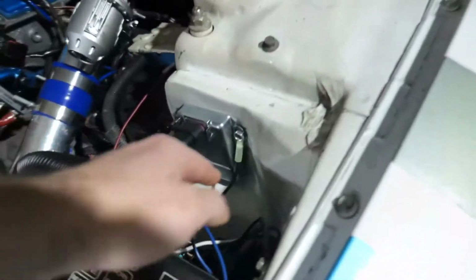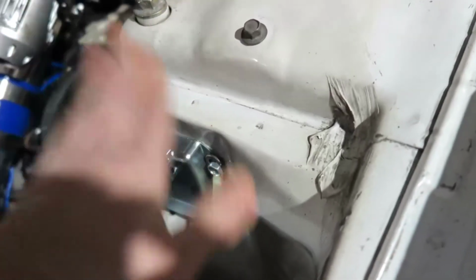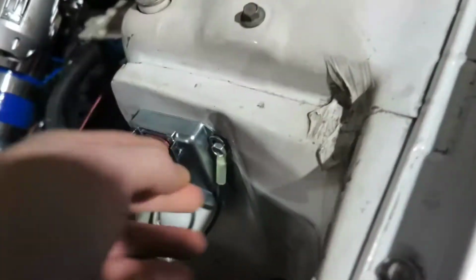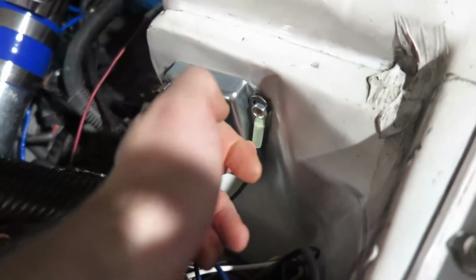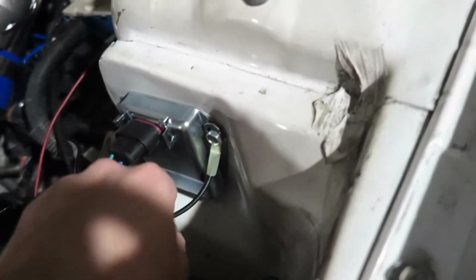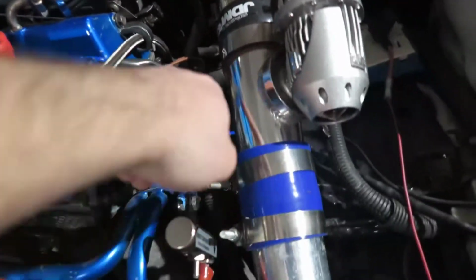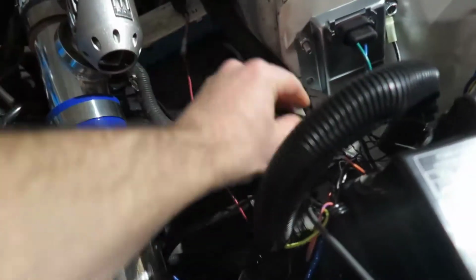And one last thing that is important is this gotta be very well grounded, so it needs to be in your car somewhere. But here I sent it back so I could have a very good contact. And here I made a special wire, right? Thick one. Everything is 9 gauge. And this one goes straight to the engine. So my engine has a few grounds, and that's one of them. And that's pretty much it. This is going to make your car run and charge.